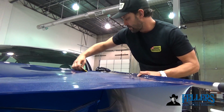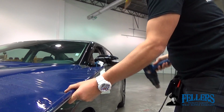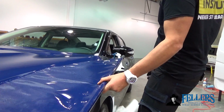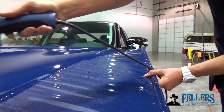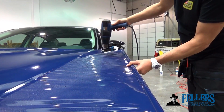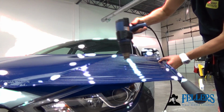If the material touched the surface, if they had to bend to the ground, they might not be able to pick it back up. And with the second mag strap on the heat gun, the installer simply has to reach over again, just like with the water bottle, heat the material, soften it, and apply. So it's a very good idea to have at least 2 or 3 mag straps on different tools to create ideal workflow, especially on tricky areas like this.